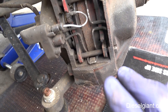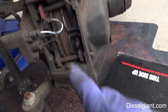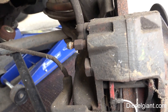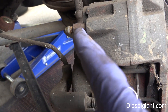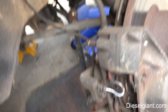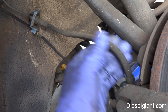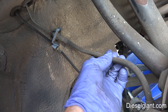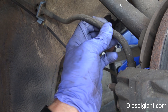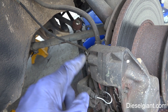This is the passenger side and I can already see there is one of the sensors missing and I don't have one on hand. What concerns me is the bleeder screw — see how rusted it is. I'm going to put a little bit of PB Blaster on there. Now these are not the factory hoses, but they actually look to be in pretty fair shape. Before I do anything, I want to see if I can remove this screw.